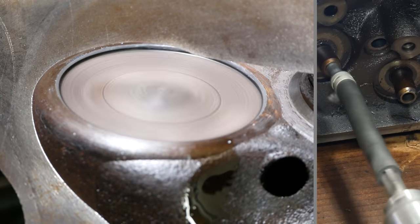They're all due for a final cleaning before installation, but it's just going to be a simple one. We'll spray down each valve with brake cleaner and give it a thorough wipe down before putting some engine oil on the valve stem and slotting it back into the cylinder head. After all that care we took to keep them in order, we better make sure we get them back in the right locations. Then we can drop and place our first rotator and hold up the valve to install an umbrella seal. These seem like a good fit on the valve stems. Then we'll drop on a valve spring with the splash guard facing the cylinder head, just like it was when we took it apart, and a retainer tops it all off. Out comes the spring compressor with the same setup we used for disassembly, which we'll get into position over the retainer and tighten down until we can fully see the keeper groove.